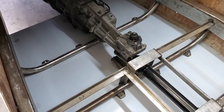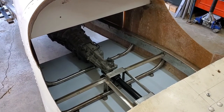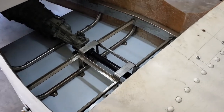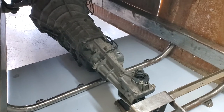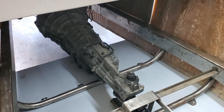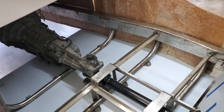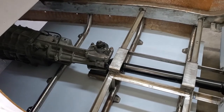Plus, there'll be a series of two-inch stainless steel washers under the pan to keep the bolt heads from pulling through. The floor was trimmed to match the curve of the body — when the panel is out of the car the edges look almost rough cut, but when it's installed it follows all the little deviations in the rockers like a tailored stitch. The floor extends forward under the transmission and into the engine compartment, up to just where the transmission case bolts to the bell housing, which is where the return joining the firewall and belly pan will reside. About two thirds of the transmission ends up sitting inside the passenger's compartment — I like how it extends into the cockpit over the floor pan instead of hiding under a transmission tunnel like every other car. It should look pretty stellar once the interior is all in.